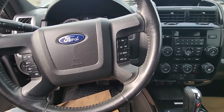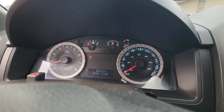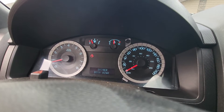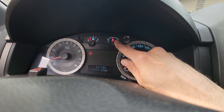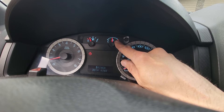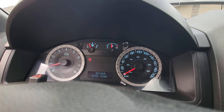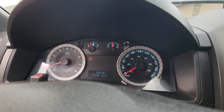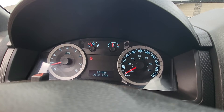Leave it idle for as long as possible — maybe for one hour or so. This is the best way for Ford to relearn the throttle body. It's going to start relearning once the operating temperature gets to the middle. After that, take it for a longer test drive — drive it on a highway, then take it to the city, to the traffic lights, drive it as much as you can. The shifting patterns should also relearn, and that should hopefully fix your problem.